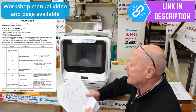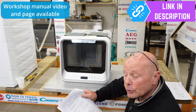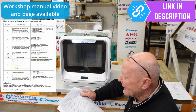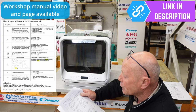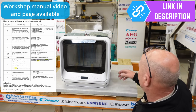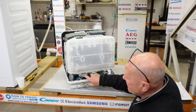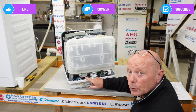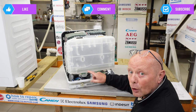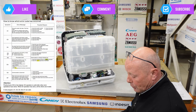This machine has a blown circuit board so I can't initiate test mode, but let me describe the error codes. E1 occurs during the water inlet step: if the flow meter can't detect the defined water after four minutes, or can't detect 30 pulses after 60 seconds, the dishwasher shows E1. At the bottom of the machine you can see an impeller that rotates as water enters, telling the computer how much water is present to proceed to washing and heating.